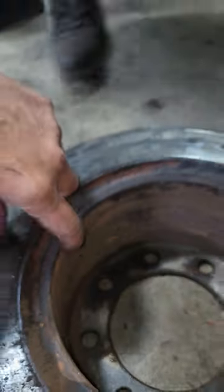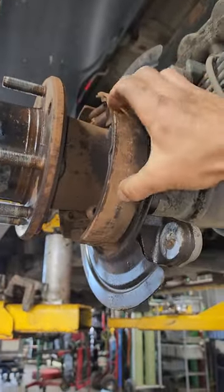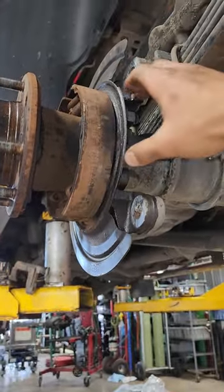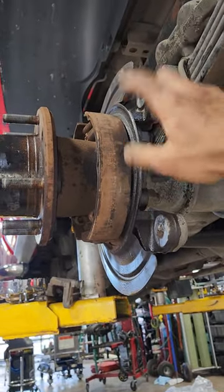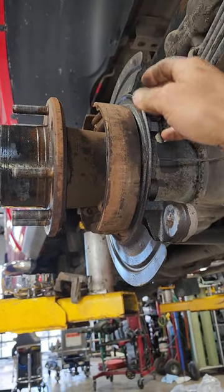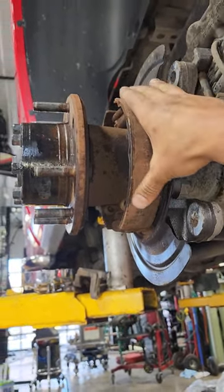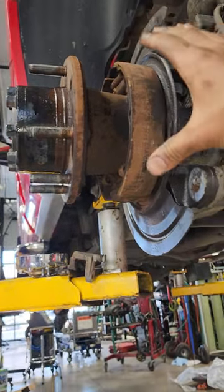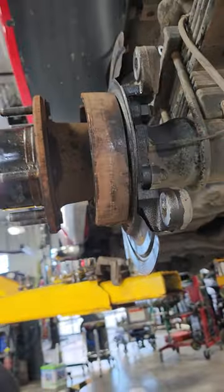I know a lot of people have made fun of the other videos we posted about how we do this — so we don't damage everything and we can put the new rotors on and still have parking brake shoes. Once you bend the backing plate, it's not square with the rotor anymore, and the shoe doesn't sit perpendicular. It's very hard to adjust them, and your customer is going to complain that the parking brakes don't work right.